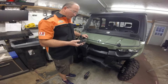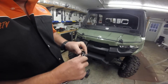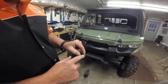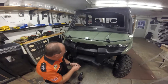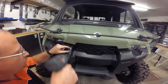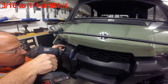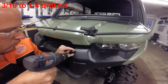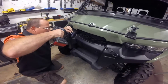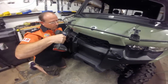Now that we've got our bungee cord out of the bag and our loop straps — the way this is going to go in is there'll be a 5/8 bolt with a flat washer and a lock nut. Those two will go to the inside of the plastic. We're going to put this loop strap right on the corner of this plastic. We're going to have to drill a 3/16 inch hole on both sides. We're going to put the screw in, then a flat washer and a lock nut.